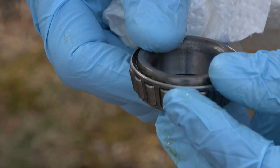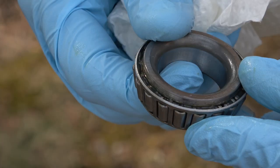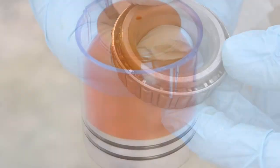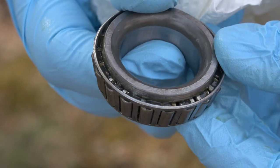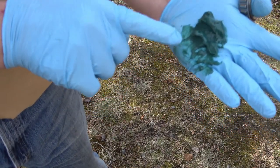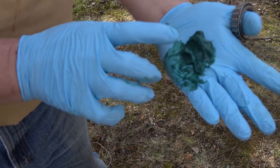This one was really clean to begin with — we didn't really need to rebuild these — but it's good preventative maintenance. When you add grease to these bearings, you're not just putting grease on the rollers; you actually want to drive the grease down between the rollers and the race itself. Every mechanic I talk to says to use true axle bearing grease, not high-pressure greases, as it's designed to flow at the operating temperatures of your wheel bearings.